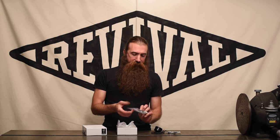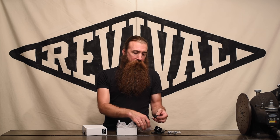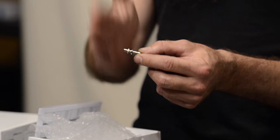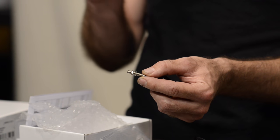Then we also find a bag full of lots of other stuff. This is some mounting hardware and a speed sensor that you will need to mount on the wheel so the gauge can tell that the wheels are turning. We'll start with this speed sensor. It's a very simple instrument — just a magnetic reed switch. There's a pair of contacts in here, and when a magnet moves close to it, it will cause those contacts to close and send a signal to the gauge, basically counting one pulse. You will then calibrate the circumference of the wheel and program in the number of pulses per revolution. If you have two magnets, that would be two pulses; one magnet, one pulse. Pretty simple.